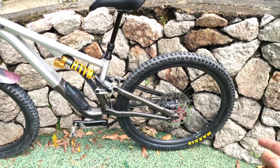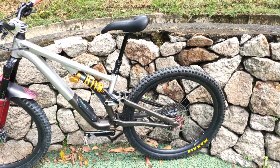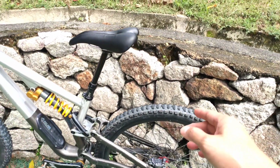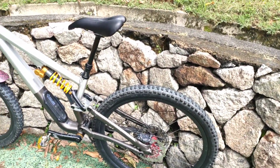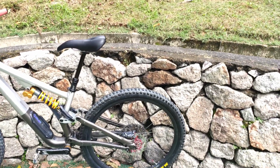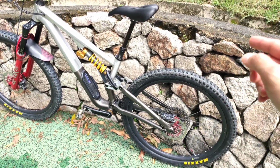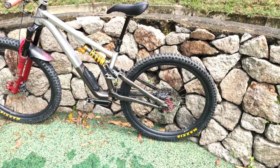But at the moment I feel that I am bottoming out my rear tire more often than not. In the past 2 rides, with the rear tire at 27 to 25 psi, I have felt myself hit the rim twice, and I have a tire insert in there. I'm running a big foam insert, a Vittoria Airliner in enduro spec, and I don't know why I felt the rocks hitting the rim the last 2 rides that I've been out in Kiara.